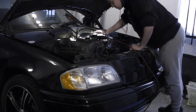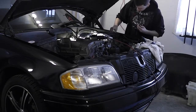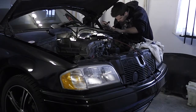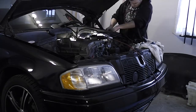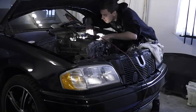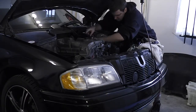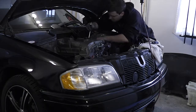Next step: remove the ignition coils. For that you will need to fish out the long ground cable that goes from the coils to the grounding point on top of the fender. Then simply unbolt the coils and let them drop. You will have to wiggle them out while using your finest geometry skills to get them past the cruise control linkage. There is a gap between the starter motor, cruise control linkage, and air conditioning low-side hose — that's the gap you are aiming for.